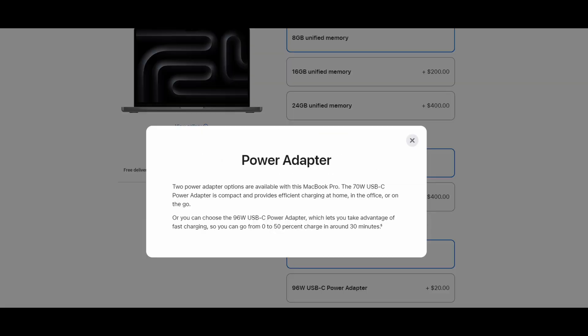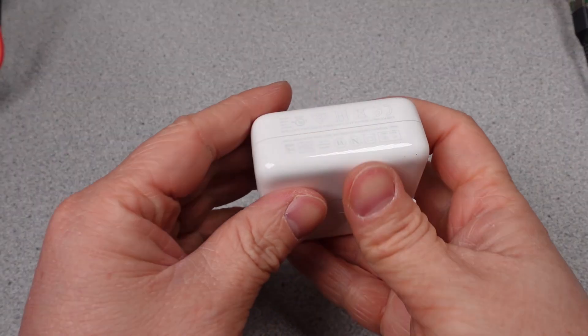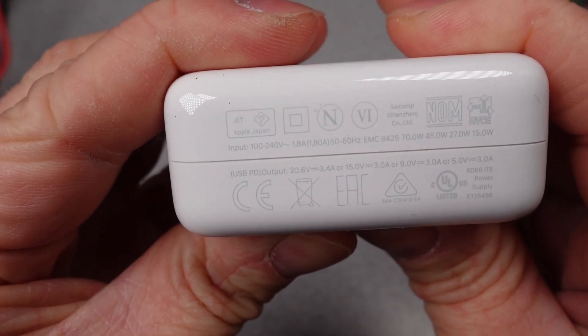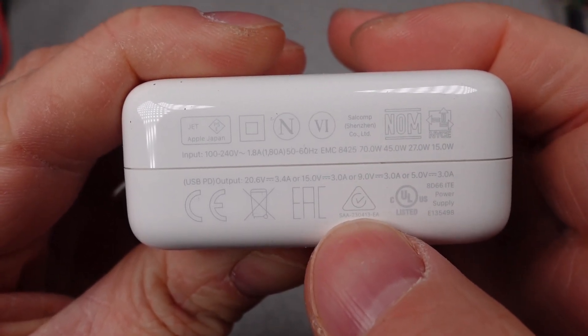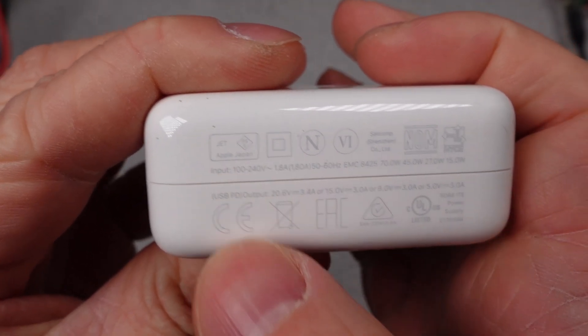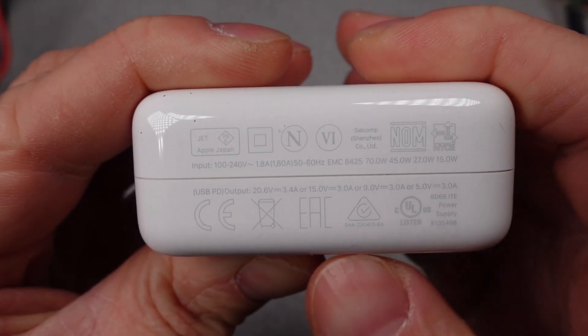Apple offers several ways of using these adapters with the notebooks — MagSafe or USB-C. The larger 140-watt power adapter seems to be only offered with the larger MacBook Pro. The adapter has a bunch of marks on the sides. In the U.S., I'm usually looking for a safety mark of some kind and a six in a circle indicating it meets energy efficiency requirements laid out by the government. In this case, the adapter has both. It also has markings for many other countries, which is not a surprise as this adapter with its changeable input cord works all around the world.